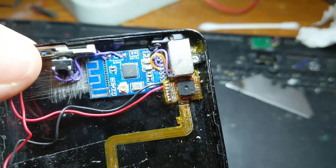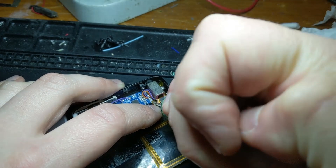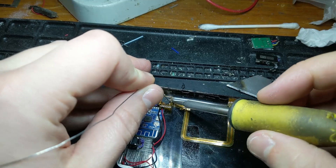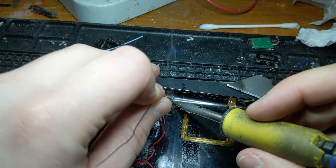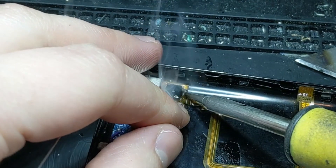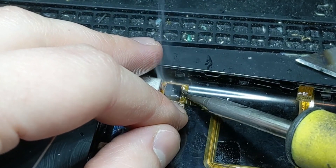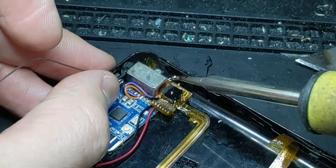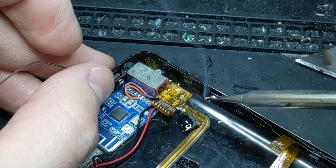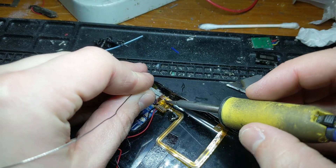Once that's off we can move over to the clicker and remove that using the same process — first by applying flux, then just holding the soldering iron on each pad till it's free. Be careful when removing it as there's a bunch of small components on the side of that flex cable, and if you damage any of them or tear the flex cable you can break it and you'll have to order a new one. That's probably one of the most fragile parts on this whole iPod, and a tear usually results in no audio or even no click. If you do end up damaging your headphone jack flex cable, I have those for sale on my website — I'll have links in the description. You can buy one from me or I'll have AliExpress links as well if that's cheaper for you.